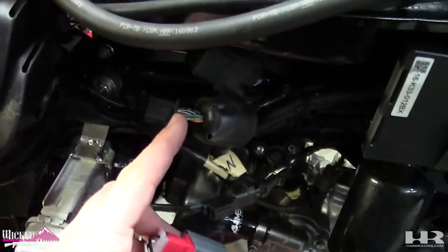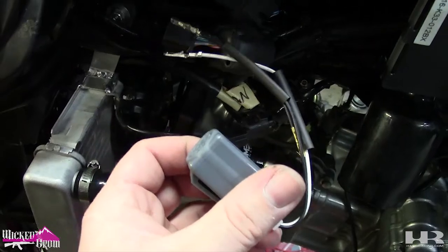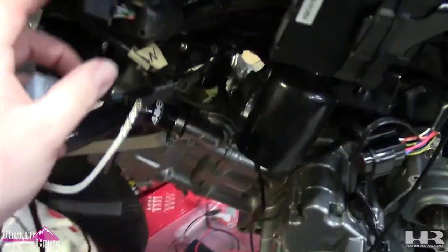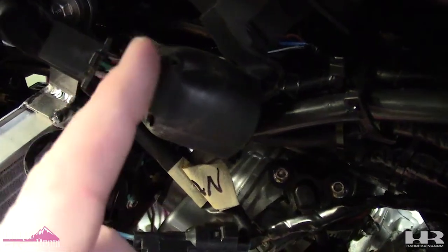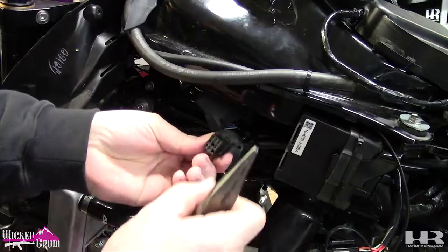We're going to take some pins out of here, repin it, and then plug the pins from the relay from TST into this harness. It's super easy. I'll link TST's video in the description because their video is really good on how to do this. But basically, we're going to be taking the gray wire and the black wire from this harness, plugging it into the TST one. Super easy, so let's get doing that.